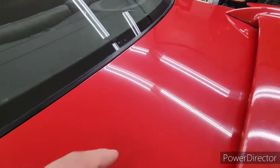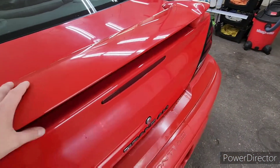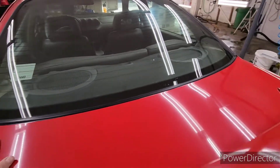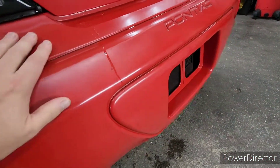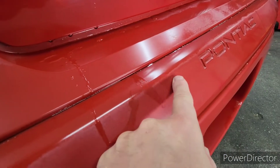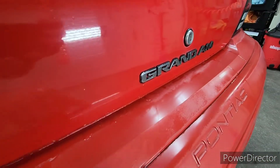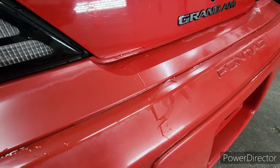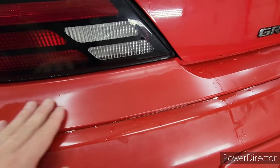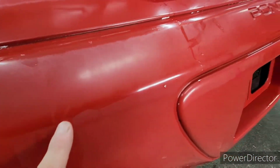You can really only see the scratches through the lens — you just can't see the lack of depth in the clear coat. So how do you know if it's failed? Well, all this clear coat is still intact, it's getting pretty close, needs to be restored. This bumper is a really good example — bumpers always go first. You can see the clear coat is gone. This is actually the clear coat that has just become brittle. Clear coat is essentially plastic. There's no clear coat whatsoever here — you can see how it's peeling, it's kind of turning white. That's really the best indication. It actually looks like somebody took an eraser and just started erasing it. It's gotten so thin that the clear coat is no longer transparent and now becomes visible.